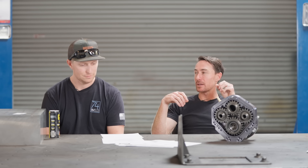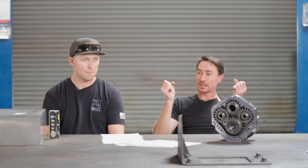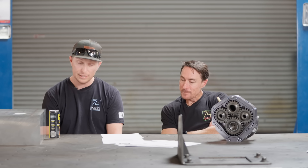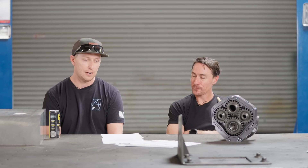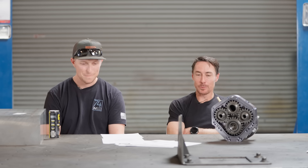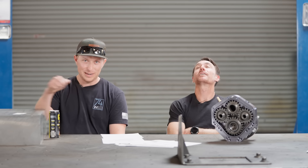I don't like heims for steering — except I do like a heim on a track bar because it's so rigid but allows it to flex. The second that a track bar heim starts to feel any play I'd change it out. I like heims or uniballs on a track bar because it gives the most rigid mount from axle to chassis; when you start getting play in those mounts it accentuates in the form of death wobble. It could even be suspension mounts pulling off the frame.